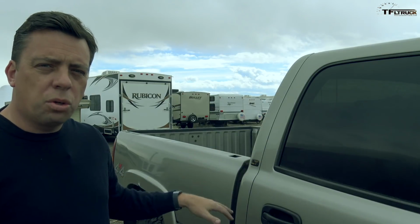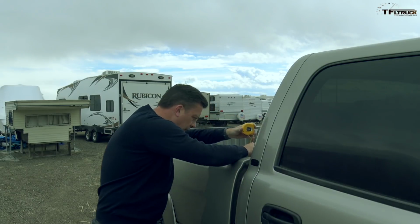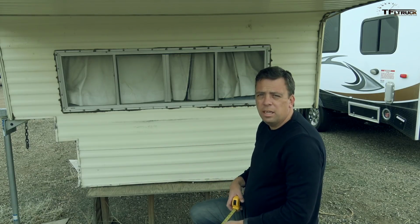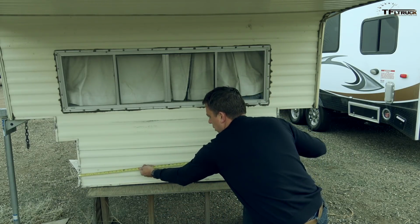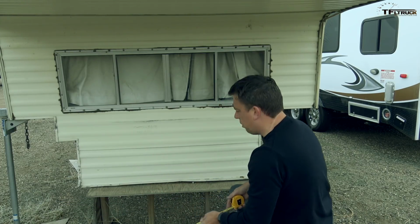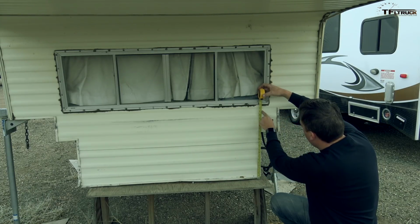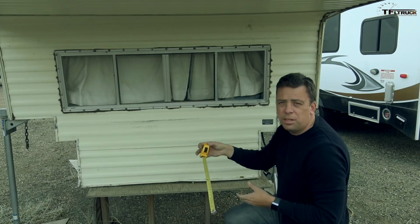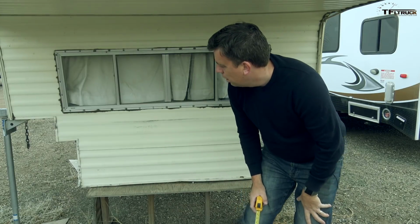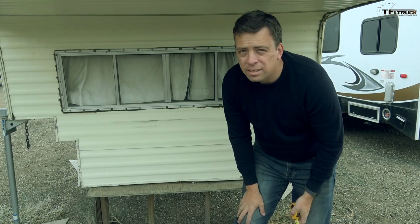But for an older truck, the bed is actually shallower. For my 2002 Silverado, the bed depth is actually 19.5 inches. The floor of it is basically a 4x8 piece of plywood, so 4 feet wide and 8 feet long. But here's a crucial measurement. It's from the floor of the camper to the rail. The top portion of the bed rail on the camper is actually 20.5 inches. So it will clear the bed rail on my truck, but not on the new one. And yes, you could put something underneath the camper, but then you're raising your center of gravity. It's not a great thing.